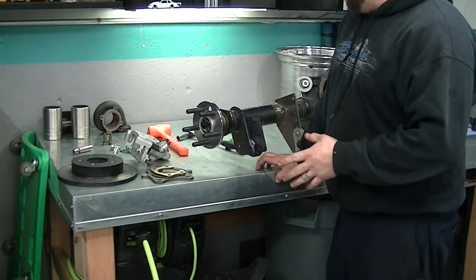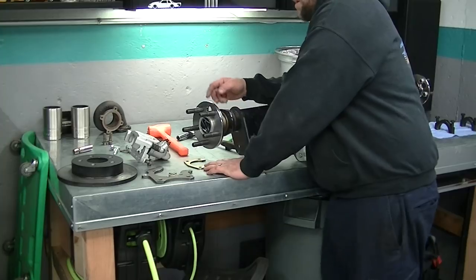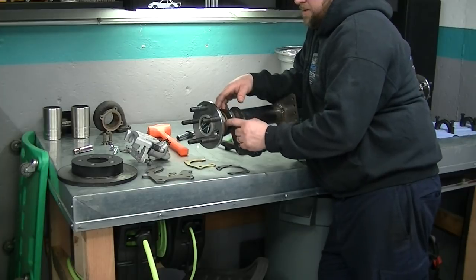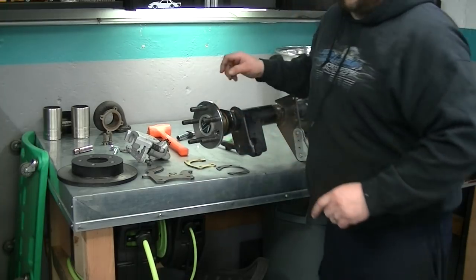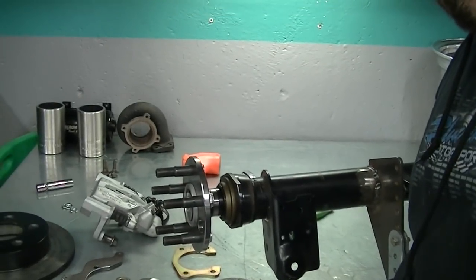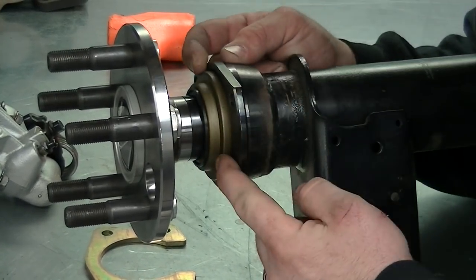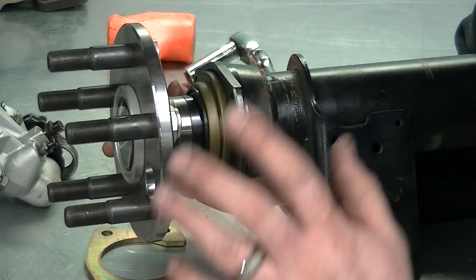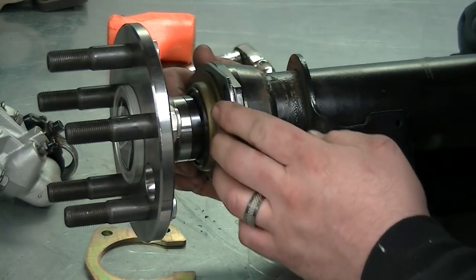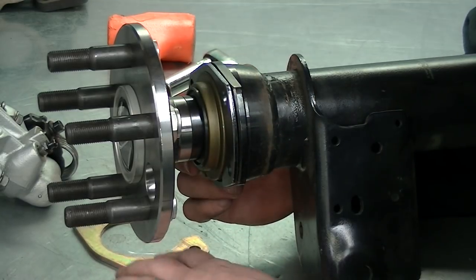Now that you have your rotors drilled and your backing plates cut with all your hardware, you can go about assembling this. I was questioned when I started because this axle seal sticks out pretty far. I stuck the backing plate in there and it goes around the seal — I thought that's not going to hold my axle in. That's when I found out about the retainer plates.